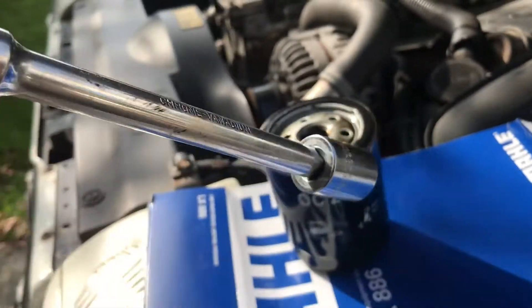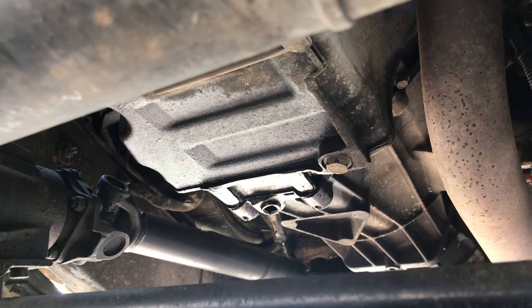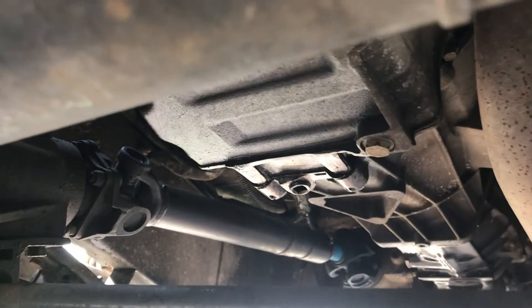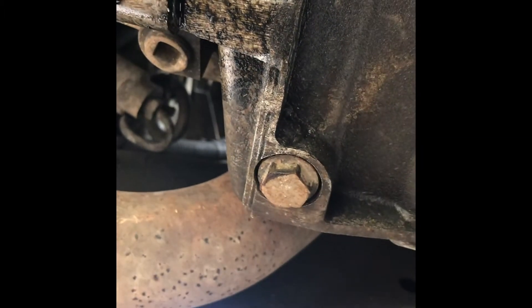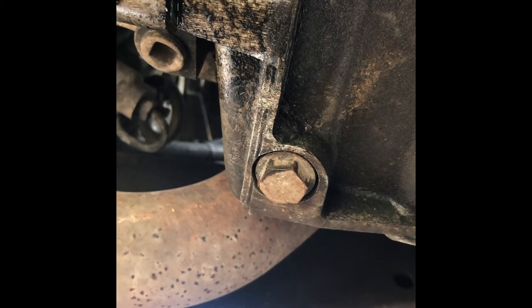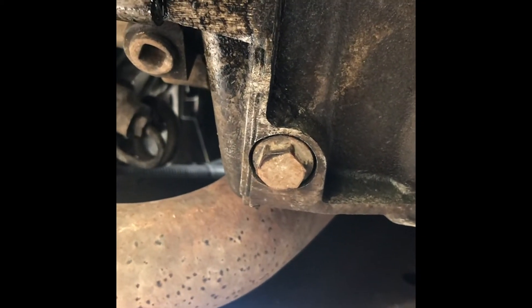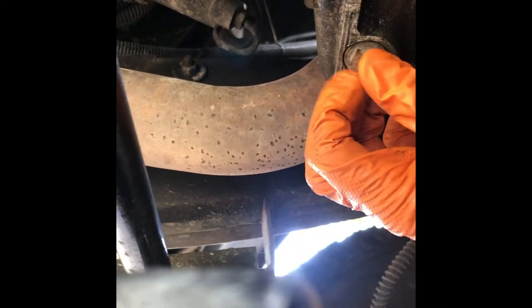So I'm underneath the car — underneath the Defender — and there's the sump drain. I'm going to get a 17mm on there and crack it off. I've got a bucket underneath to catch all the oil. That was hard work — I had to use all my strength to crack it off. Next time I'd use a 17mm ring spanner rather than a socket, to get a bit more torque. I nearly took the skin off my knuckles. I've got the bucket below ready to catch it. I pushed it in against the thread so I could feel when the thread's gone, then lift it quickly rather than having oil run down my hand. There we go — it all ran down my hand. I've also got cardboard on the floor for spillages. There's seven litres of oil should come out — and we've got seven litres to put in.